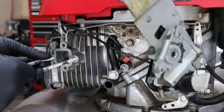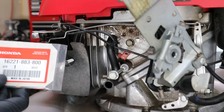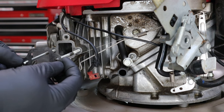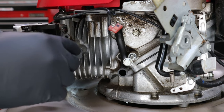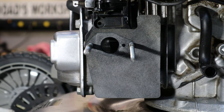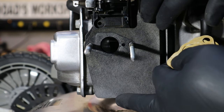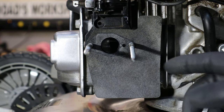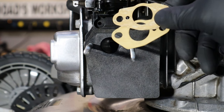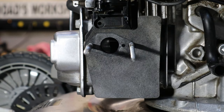If you bought an OEM part, it's going to come with four gaskets, and you're going to reuse one of them — five total. First up: insulator gasket. Second: thermal wax assembly. Now, if you have this type of air guide — a gasket or fabric or soft material, very flimsy — this was found on later models. If you have this type, you do not need those two gaskets; the air guide itself replaced them, so you can pitch them.